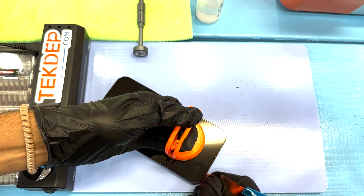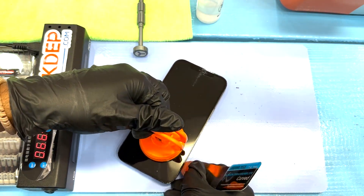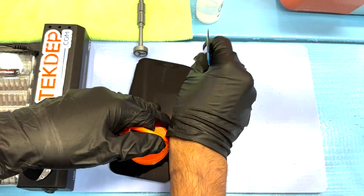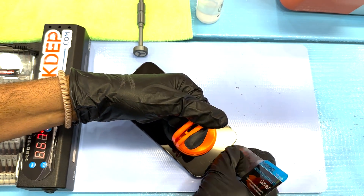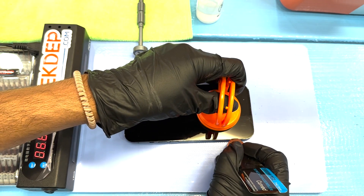This is pretty important, as you really want to make sure you don't rip the cable on the right side of the phone — those are the connectors to the LCD and the digitizer, or touchscreen. In general, we're trying not to pry too hard when disassembling the screen, just gentle and methodical all the way around with some light prying to progressively get rid of that adhesive.